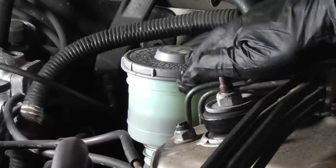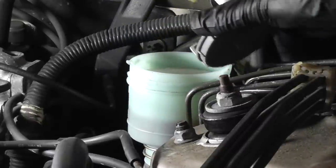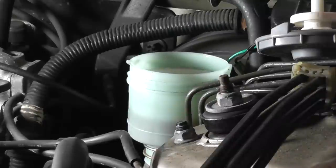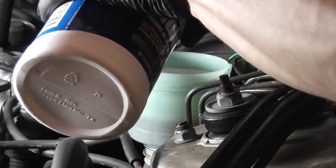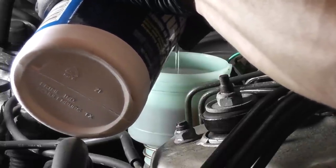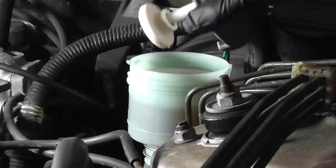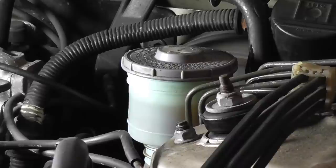And after you're done, top off the fluid in the master cylinder. Make sure to reinstall the cap in the right direction. There's an arrow on the cap that should point towards the front of the vehicle. Otherwise, the wires from the brake fluid level sensor will get in the way. Remove your piece of wood propping the pedal, and you're ready for a test drive.